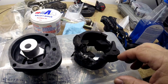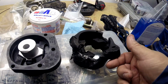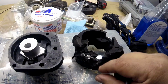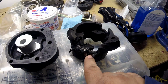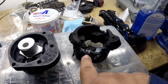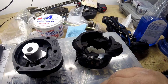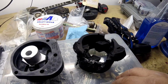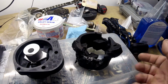So what I did to get this out is I pulled on this side. It's like a metal flange around here. Pull on this side, took a chisel to here, you can see that, and I kept banging it at an angle up, and I did it along here. What you're doing is pulling it away from the housing, a less contact surface, and it starts to collapse in on itself. Eventually I took a pry bar to the outside flange here, and it just pops right out.